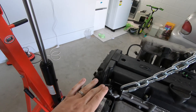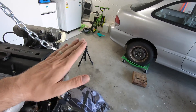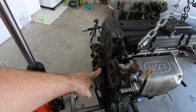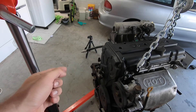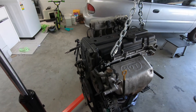Welcome back for another episode of this build where we're going to be taking things off the engine, replacing a few different things, and getting this engine tidied back up ready to go back in the car. Today we have to take off our power steering pump, the air compressor, the air conditioner on the other side, and we'll be taking the heat shield off, cleaning up the exhaust manifold. We will be replacing some belts — the drive belt down here which also powers your water pump. I'll be putting a new water pump in, a new thermostat, and we'll be taking the belts off for the air compressor. We'll also be putting a new timing belt on, because I'd rather put new stuff on now knowing it'll be right to go.